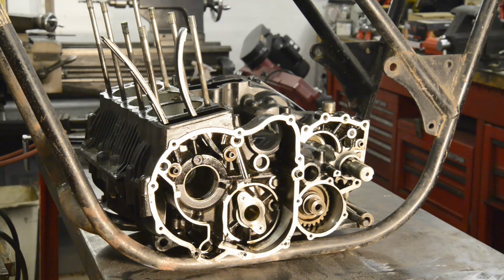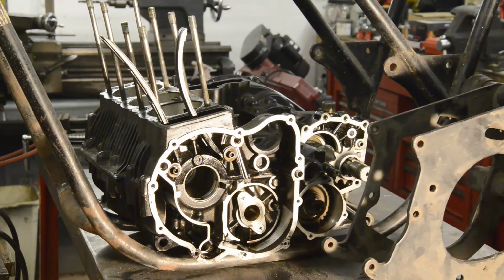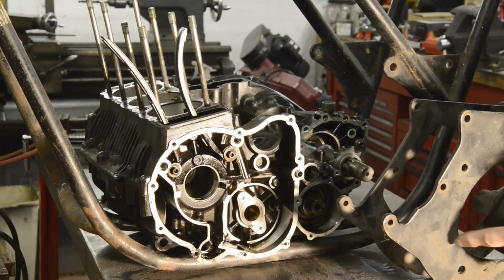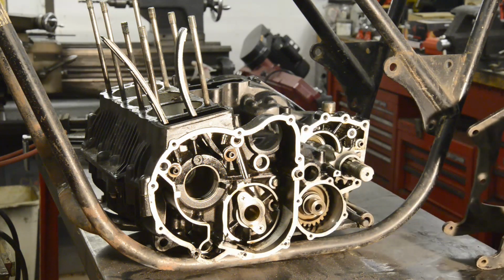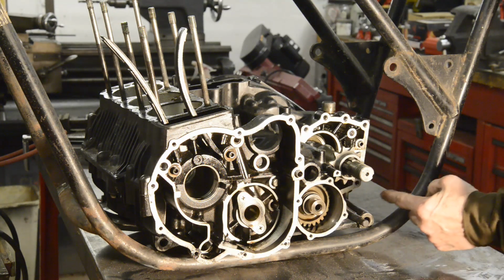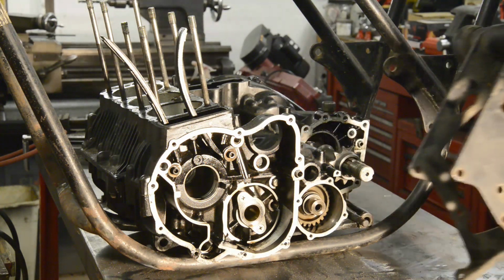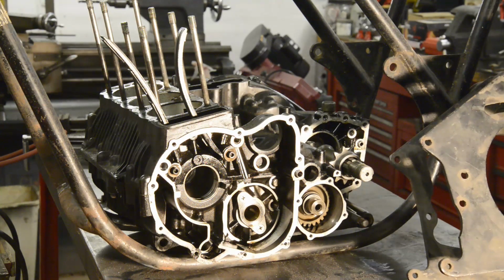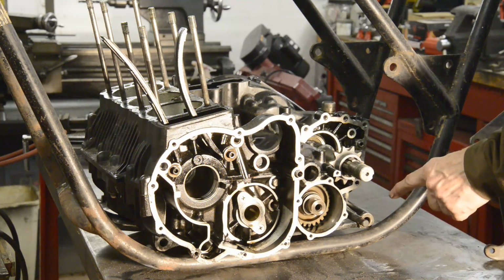And then I suddenly thought to myself, wait a minute, if this point, this one, is fixed, then anywhere on these plates that I measure off and do exactly the same on both sides. So I thought to myself, right, what I'll do is the mounting I make here, I'll make it big enough to encompass the engine mounting. So now what I can do is we'll make our cardboard template, so this will go in. Then we'll make a plate that will mount to this and to the engine.